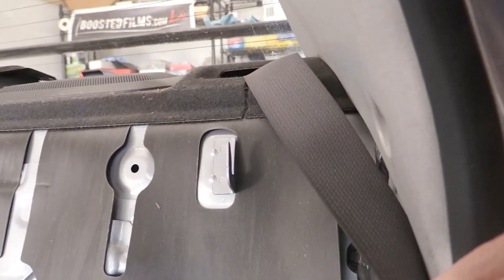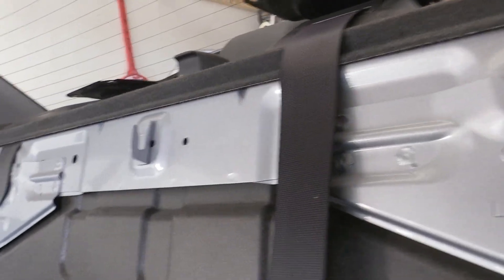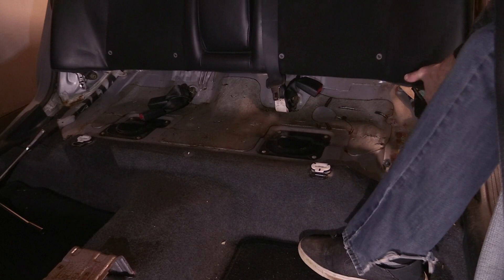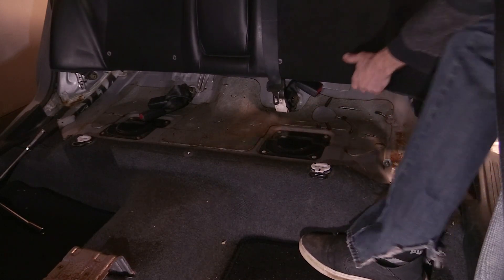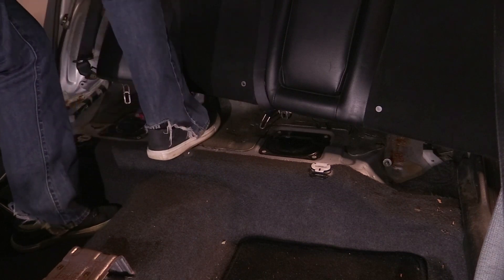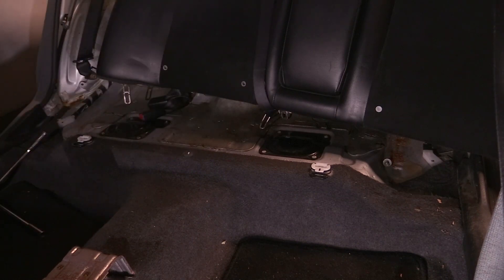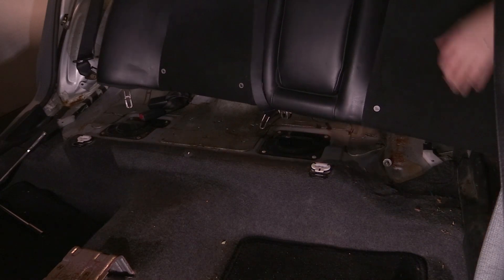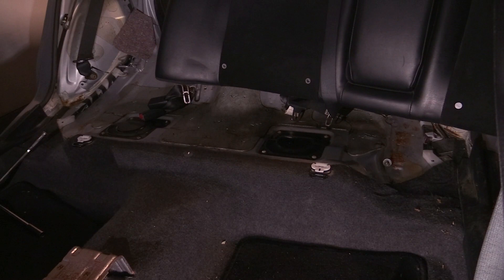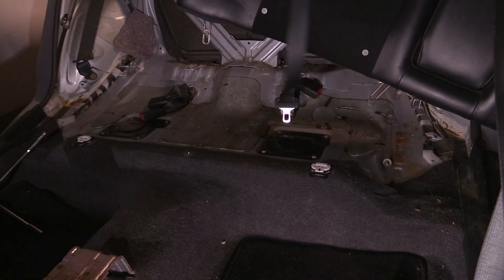You'll also want to get both of the outer seatbelts out of the way — each outside seatbelt you can move aside. Then grab the seat and lift up. For the middle seatbelt, you could unbolt it if needed, but realistically you should be able to get the top portion of the back seat out by pulling that seatbelt out of the way. Then slide the seatbelt over and take the seat out of the car once it's released from the hooks at the top.